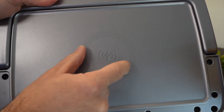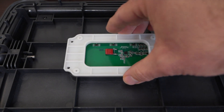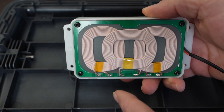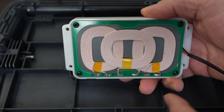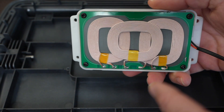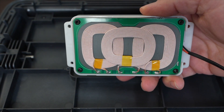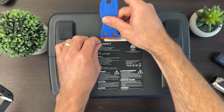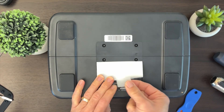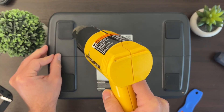Other wireless chargers I feel like I have to get it just perfectly right. With all the screws out, let's look at the wireless charging from the opposite side. There are actually three separate charging coils, not just one, which is probably why I was getting such a good result placing my phone anywhere near the circle. To expose more screws I'm going to use a little heat with a plastic razor blade, hoping I can put everything back together and you'd never know I'd opened it up.